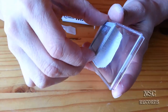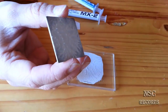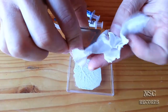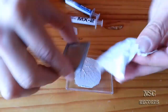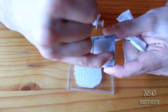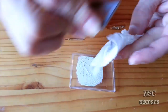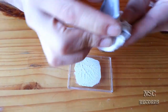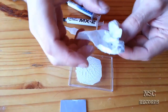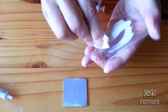Every chip has a lot of contacts down there, the solder bubbles, we can say the solder circles. When your console was hot for a long time, running very hot for years, it can be dangerous, because when you open your console, you must be afraid that the contacts between the board and the chip get broken. It just needs one contact. When one contact is missing, you get this error. The yellow light of death is just the error that a contact is missing, so the console doesn't turn on.